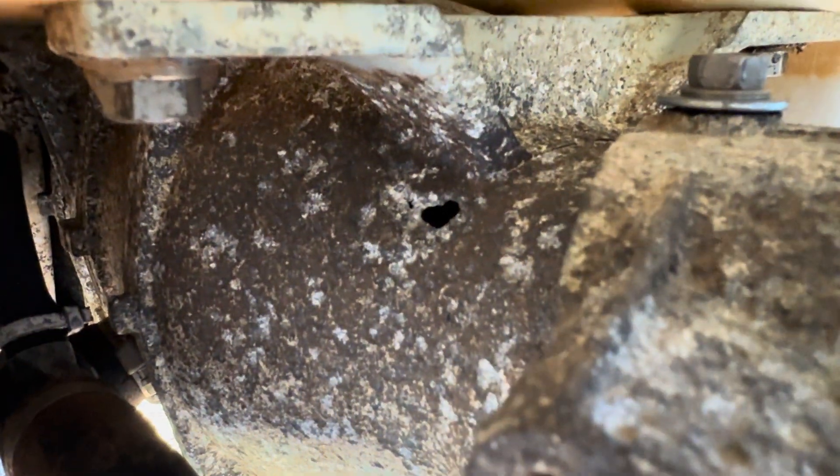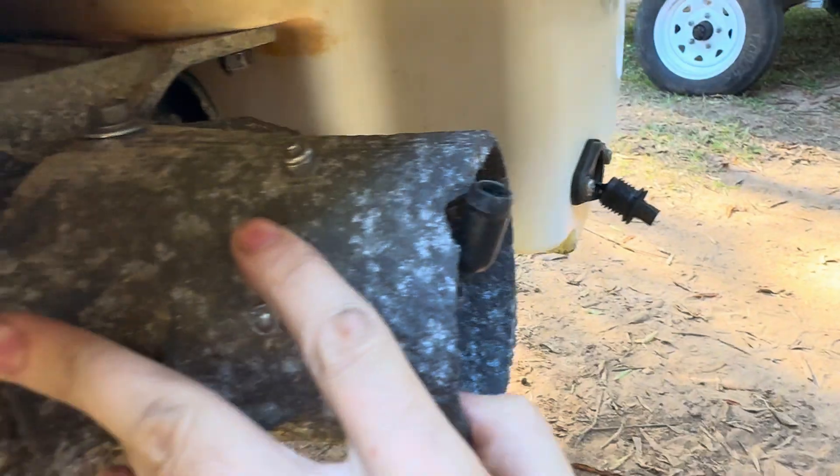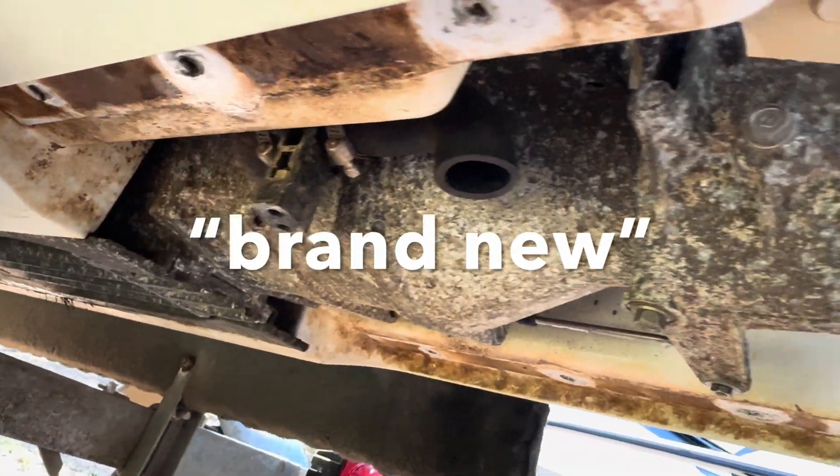And the rear nozzle, as you can see, has a hole in it. And yeah, it's on its way out — this is obviously on its way out. So pretty much I am completely swapping in a brand new jet pump.